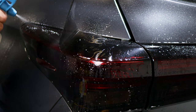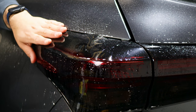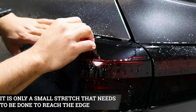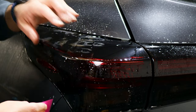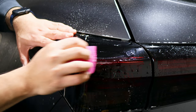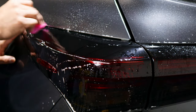Lift the film to apply slip solution so the lens and film don't dry out, making it easier to stretch. Start stretching and as you stretch, tack down — stretching only until it meets the edge, so these are light stretches. Stretch, hold in place, tack down, help it conform to the curve, check alignment, and finish it off.